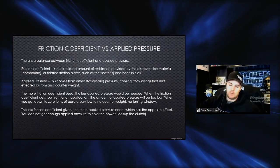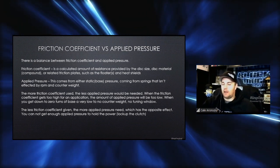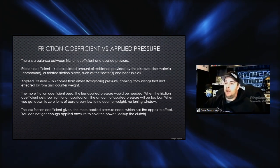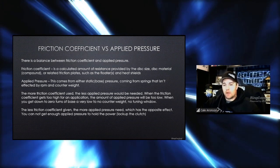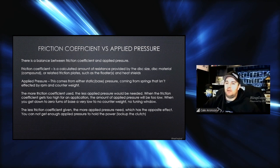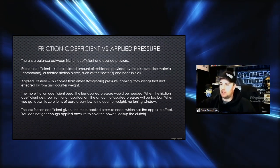The thing I always give examples of is pro cars, because let's face it, anybody that's ever gone to the lanes in a pro deal, the cover's off the can till the pair in front of you is making a run, because that's the last decision we make, whether or not we button that thing up to make the last minute change. So gear ratio has been determined off of the weather, the track conditions, things like that. We're now making the last minute changes off the clutch.